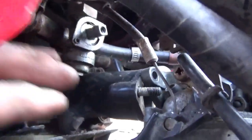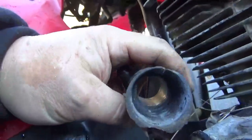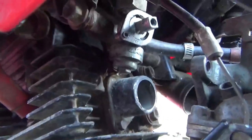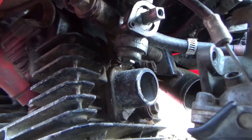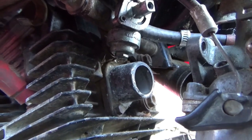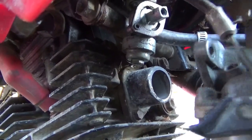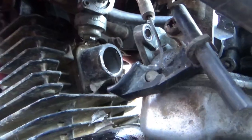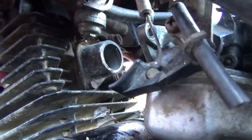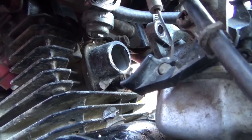So we got troubles. You see that intake manifold? It's not supposed to come off — that's the first thing they kind of ruined there. You guys can see the flange. The slide is stuck in the carburetor, so I've got to spray that. I just as soon not destroy the cable. The cable is still alive. I can get it as far as a compression check without too much trouble.